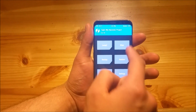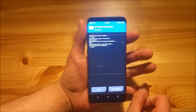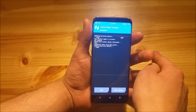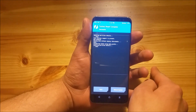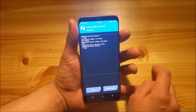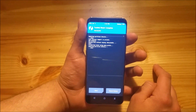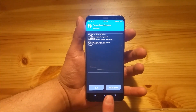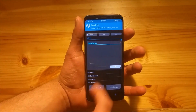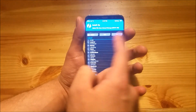The first thing here is to go to the Wipe option and do a normal factory reset. With doing that you will basically lose all your apps, all your settings, and all your contacts, but you won't lose your internal storage — so you won't lose your photos and everything else stored in your internal storage. Then you will need to go back and go to the Install option and locate your ROM.